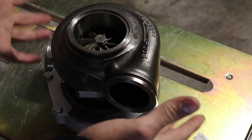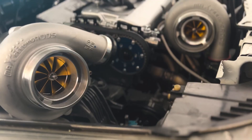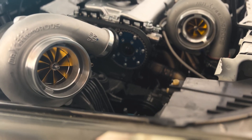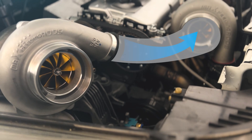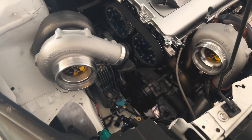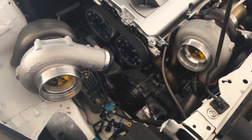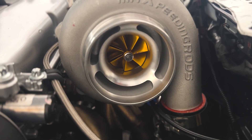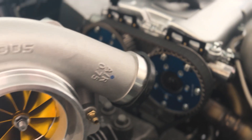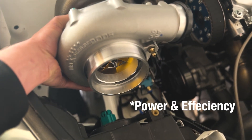So what is the plan for this turbo? There are a couple of options I'm considering. One option is doing a compound turbo setup. I thought it would be really cool to have this big turbo pick up the slack where the smaller one starts to fall off — running a tube compressing into the smaller turbo. The smaller one is a 5858 with a pretty small back housing that will choke things. The easiest plan would be to take the exhaust from the small turbo, run it up under the car into this big turbo, and the compressed air would go into what would now be the high-pressure turbo. Essentially, this turbo would make the engine act bigger, getting it to spool — a very efficient way to get more power out of your power band.